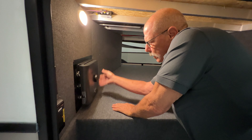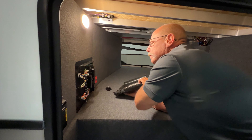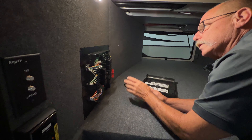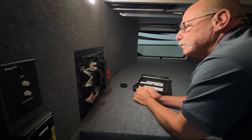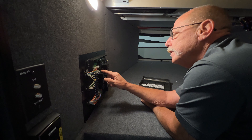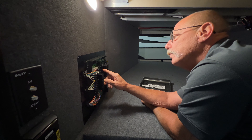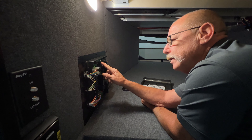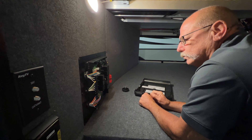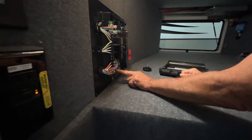This is your storage. This receptacle is an inverted receptacle — it runs off your solar and it's also a GFI. These are hookups for your TV, satellite or cable. If the campground offers cable it also runs off your antenna. These lights on the bottom here: you'll see two slashes on the switch — that's going to be motion. Middle is off. Single slash is on permanently.